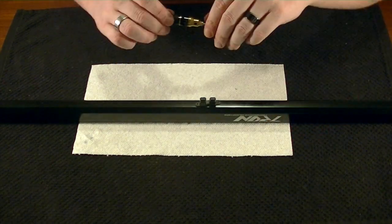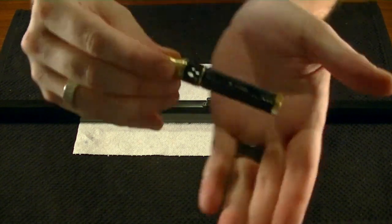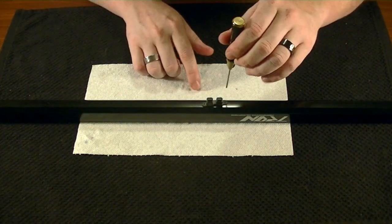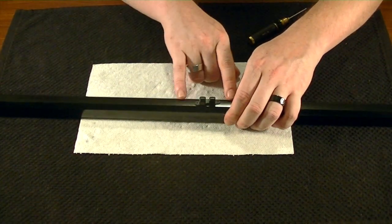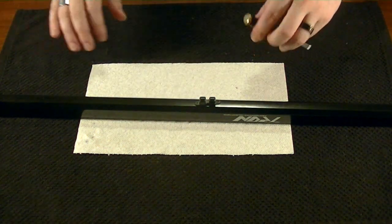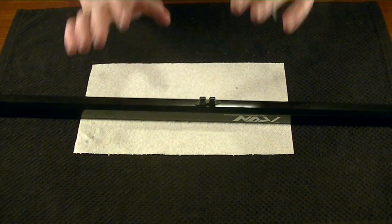Okay guys, so just a quick tip. I actually had to play around with this for a couple of minutes. Thing number one: you are going to need a 1.5 millimeter hex wrench. I was kind of thinking that it might use the 2.0, but it doesn't. One thing you don't want to do is once you feed in the push rod and you get that little bracket sat down on there, I kind of just lightly tightened one and then got the other one to where it was a snug fit. But I made the mistake of then removing the bracket off and the bolts were still loose and I had no way to get to them. So I sat here for the last couple of minutes fishing this in and out trying to get back onto those bolts. It is a little bit tricky to do.